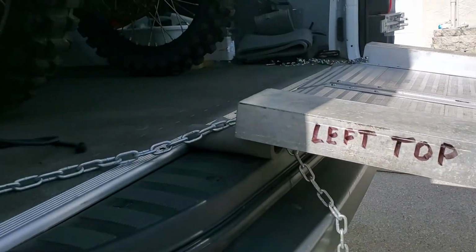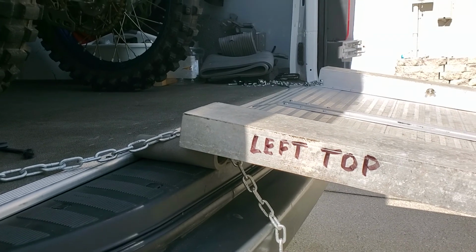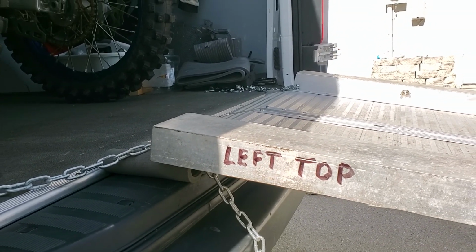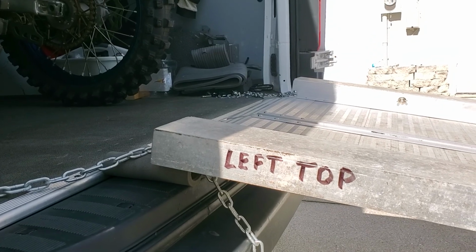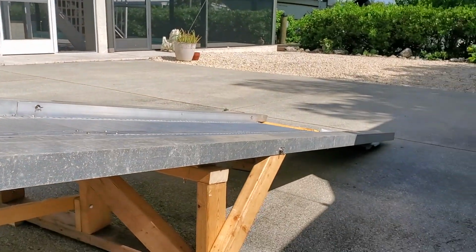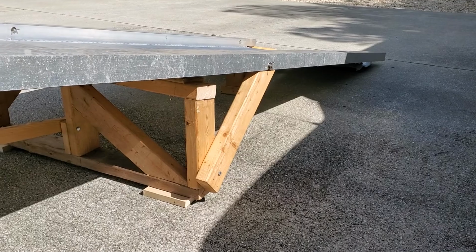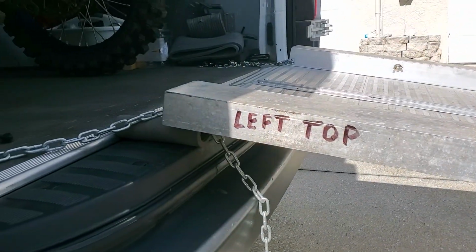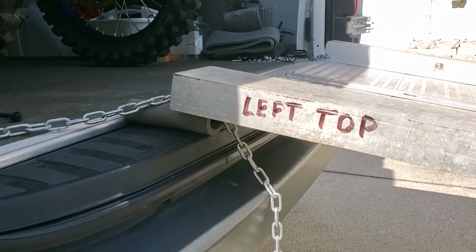So you create this lip. And in my first experiment, which I knew was a little problem, I squished the suspension in the van, bringing the Harley up, and the ramp actually slid forward on my little abutment, because it was teeter-tottering towards the van because the van was giving way with its suspension. So those are your tricks.